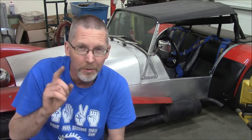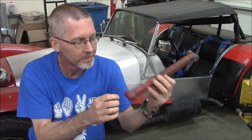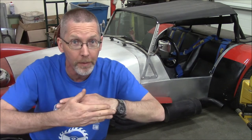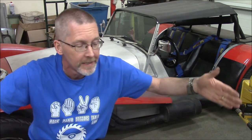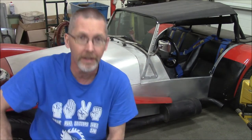I like the rod ends, and I really think I'm going to replace the upper trailing arms and the panhard with the same thing — just to get rid of the non-compliance that the rubber bushings cause, because there's not a lot of room in here for any give with the rubber. There have been studies along the low-cost Super 7 replica crowd where a parallel trailing arm with a panhard actually has quite a bit of binding. A better rear suspension is a three-link where you've got two trailing arms usually on the bottom and a single trailing arm in the center on the top — that's a better way to go with no compliance issues at all. That's going in Super 7 number two. Until then, thanks for watching.